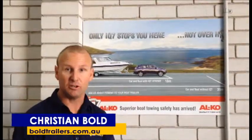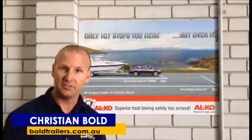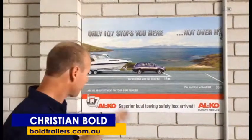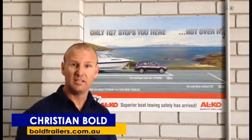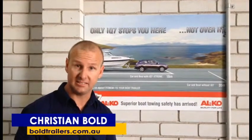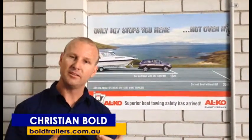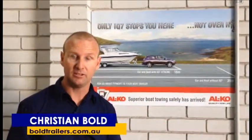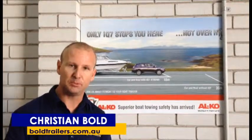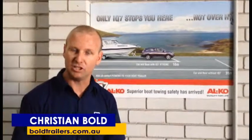This is a great unit that we fit here at Bold Trailers. Price wise it's in comparison with all your other breakaway systems which are fitted to trailers rated over 2 tonne. They look great as well and you don't have to have a backup battery like you do with your hydrostar systems. The backup battery is used on those to support the breakaway switch if the pin was to come out, to lock the brakes. That's not needed in this because the air is built up as you're driving along, so no more having to worry about replacing those batteries.